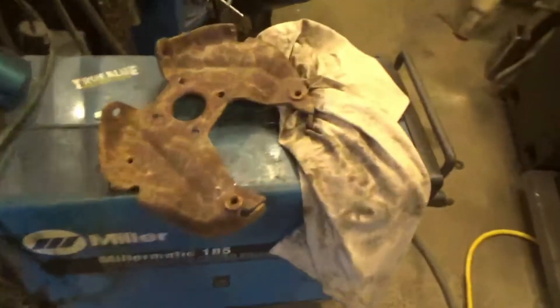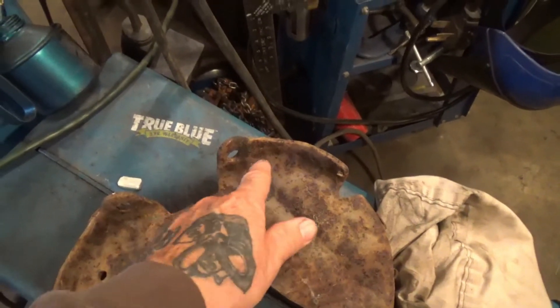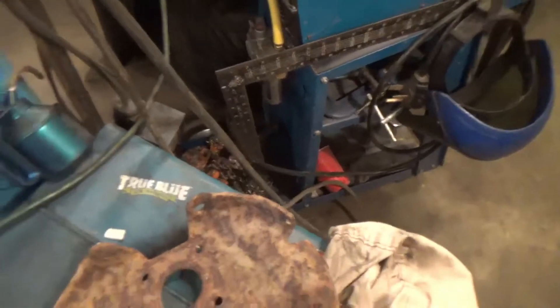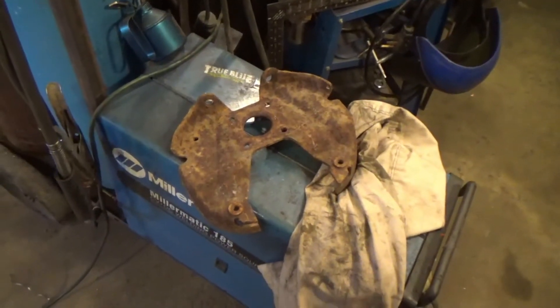The emergency brake cable clips in right there and then there's got to be a little loop that holds the cable. That was on the Cadillac mount — this is the Cadillac caliper mount, and that wouldn't have worked because of the way it is. But that little hole there is what holds the e-brake cable. I'll probably just cut this off and weld that to the rear end housing to hold the cable on. That should be all nice.